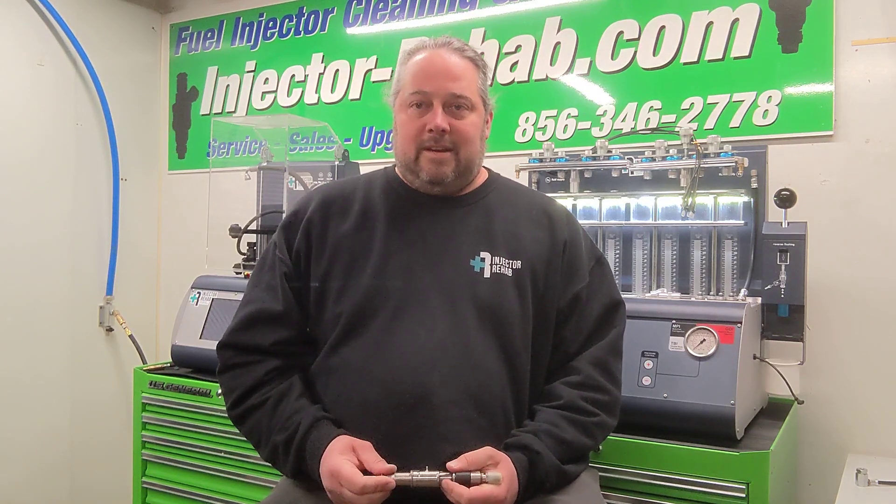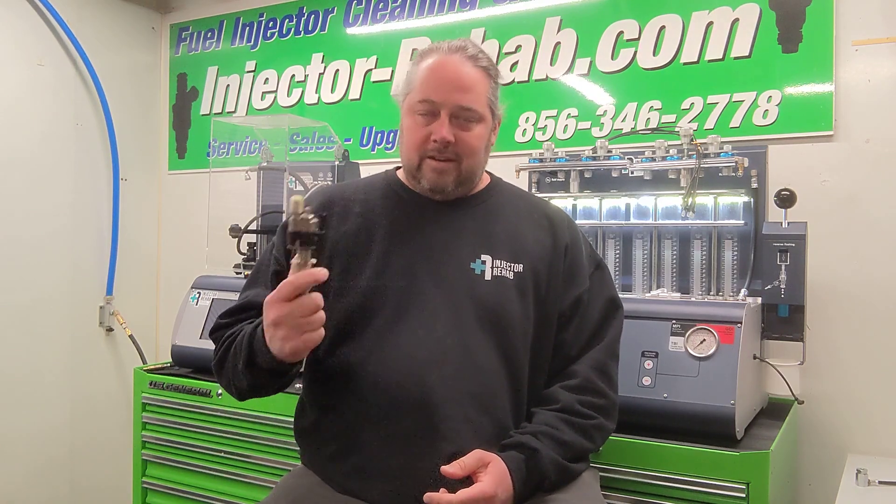As we say on our website, anything under index 11 is not really worth sending in — it does not respond well to cleaning. They made revisions after that because they were pretty much junk, so I would recommend not sending them in. Sometimes it can help them as an inexpensive alternative to buying new index 12 injectors, but more than likely it's not going to fix your issue. The test plans alone — not even factoring in cleaning or having to re-clean because it hasn't passed — you're looking at at least over an hour and a half per injector. Some injectors will have three to four hours into just one injector.